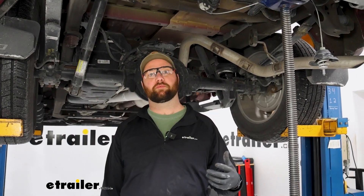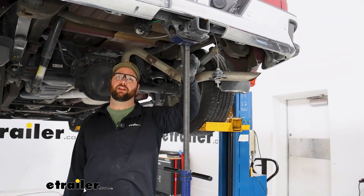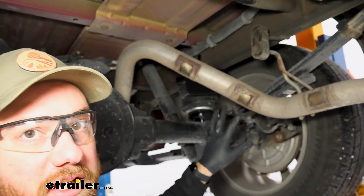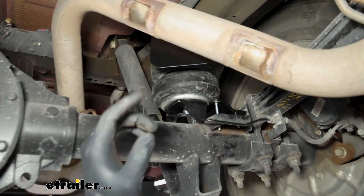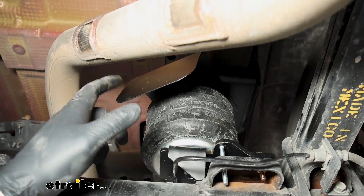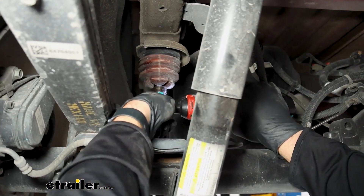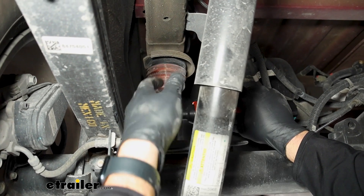To get our airbags in place, use a floor jack pushing up on the bottom of the hitch — lift up maybe an inch or so to give yourself more room. I went ahead and did the passenger side already. The only thing different from driver side to passenger side is the heat shield, so when you put the airbag up into place, make sure you put the heat shield on before you bolt everything down. We'll take the jounce bumper off using a 10mm socket — that also helps give you more room.